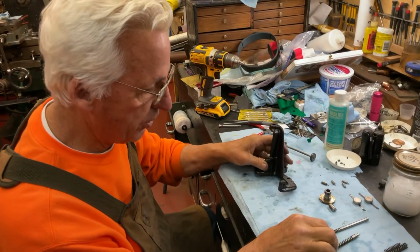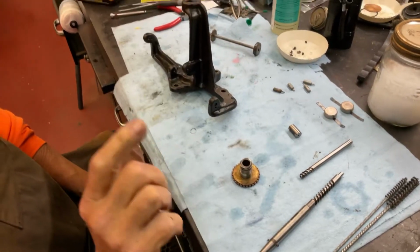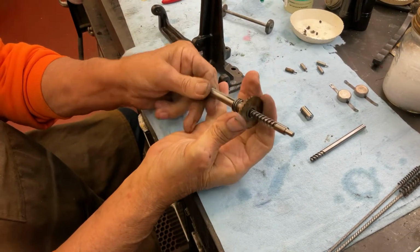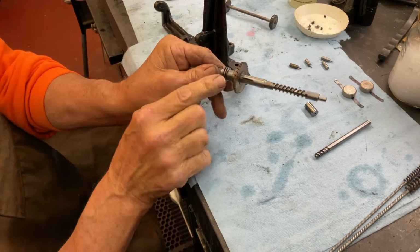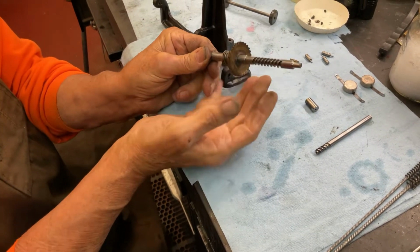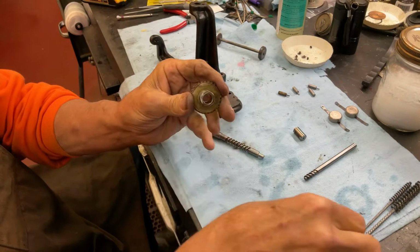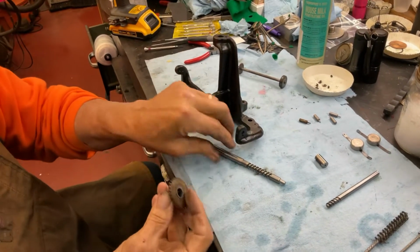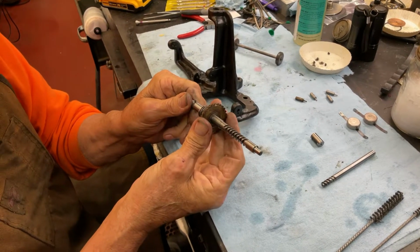Okay. So what we're going to do first is take the governor drive gear that goes on the spindle shaft here, and check whether it fits smoothly. When you put these on, you want to make sure it slides smoothly this way. Okay, this is smooth. Because you put that set screw in and it'll hit this slot, and this has an adjustment, you don't want to be going, oh man, that's tight. If this is tight going on, because there might be a burr here somewhere, I'll use a flex hone and come in here and hone this a little to smooth it out, so that on assembly this just fits perfectly and it's easy for you to adjust.